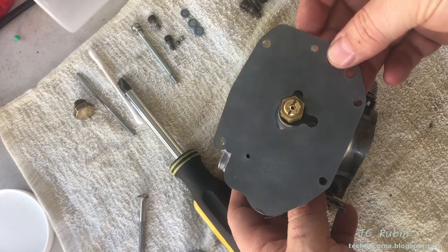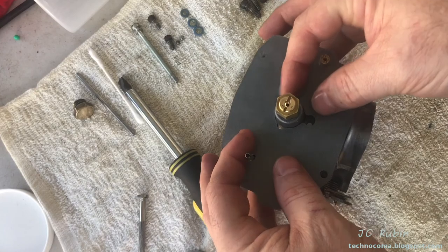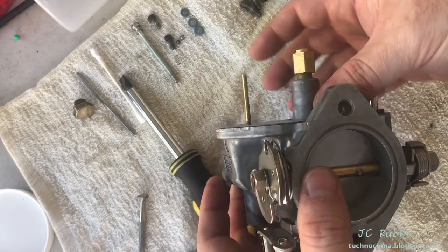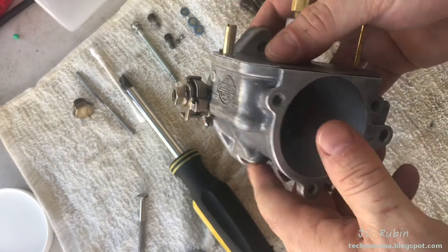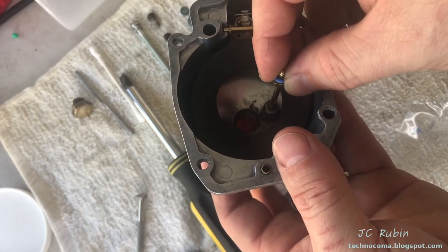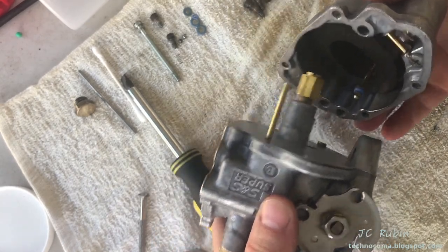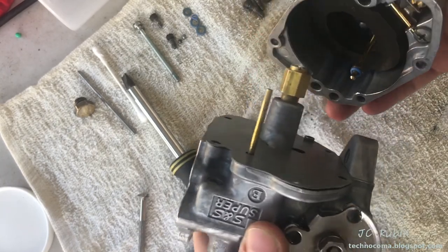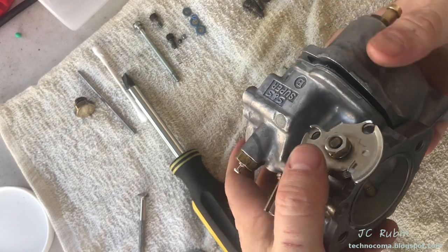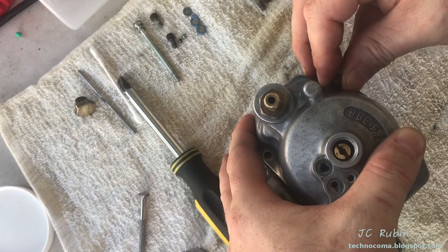I'm ready to put this big gasket on now — it only fits one way. I just have to make sure I work it over this one piece in particular as it's a tight fit; everything else goes rather easy. Once I'm confident it fits over that one nicely, I'll work it down to the bottom. There's another piece that goes around over here — taking my time, there we go. Within the rebuild kit there are a couple of o-rings; one of them is this medium-sized one and it fits right over this piece — this is the accelerator pump o-ring, lightly lubricated. Everything is then joined together carefully, keeping in mind all the pieces that interconnect including the jet, this tube, and that o-ring.